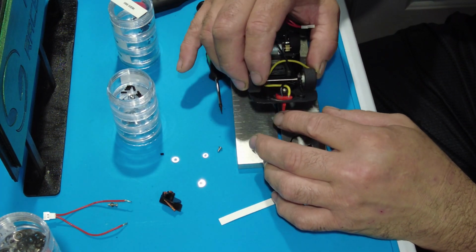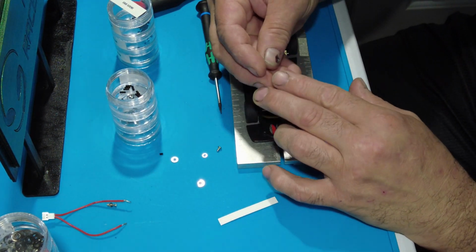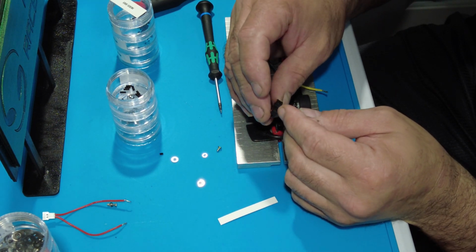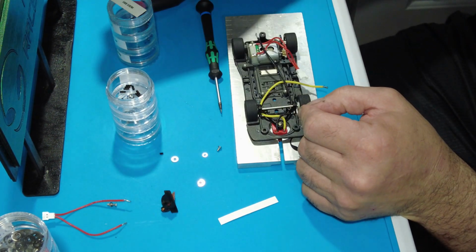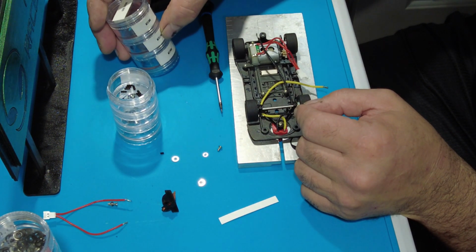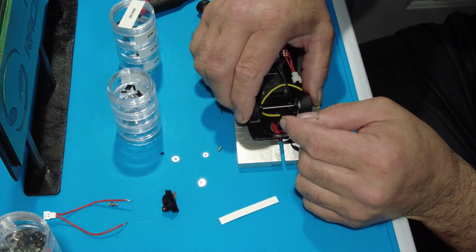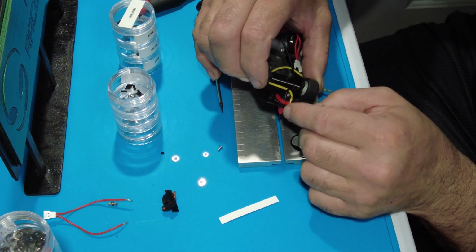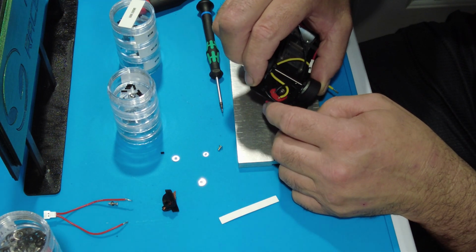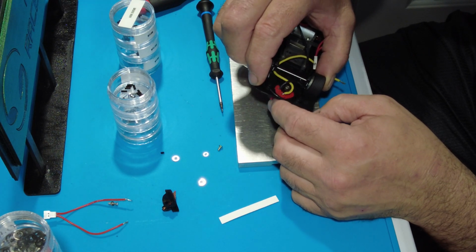And then I used my method where I used the set screws in the front instead of on the top like they did in the original ones. And they do have holes here, as you can see, for this particular guide that came with the car, if you want to put them in the front. But I also used the very short grub screw, which is the M2 by 2 millimeter. The other ones are M2.5, a little bit thicker, or longer, excuse me, and then they protrude out and interfere with the rotation of the guide. So I put the shorter ones in there, and that way I could get this action right here and it doesn't interfere with it.